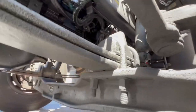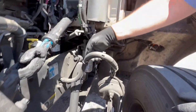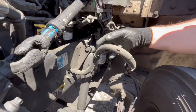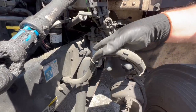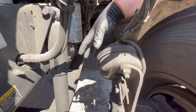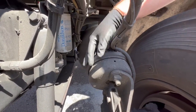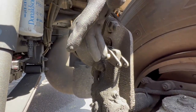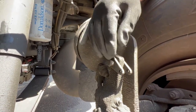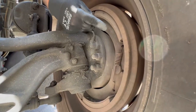You have two U-bolts, one here and one here, properly mounted and secured, not cracked, bent, or broken. Underneath, there are four washers and four nuts present. This is your brake line and the small one is your ABS line — make sure they're properly mounted, secured, no abrasion, bulges, or cuts, and no leaks. This is your brake chamber and C-clamp — properly mounted, secured, not cracked, bent, or broken, not missing any nuts and bolts. Slack adjuster and push rod are properly mounted, secured, within 90 degrees of each other, and when brakes are released there can be no more than one inch of play.